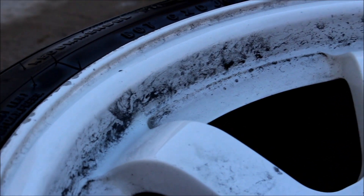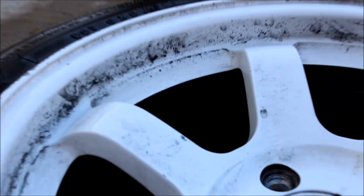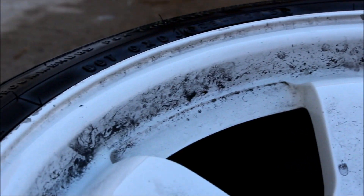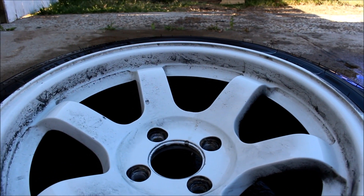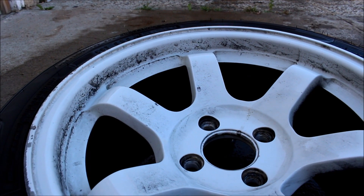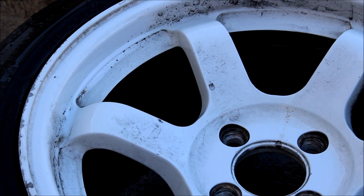See this? This is after I washed the rear wheel. People always ask me why my wheels are always so dirty. That's after scrubbing it with soap — that is from my beautiful Carbotech AX6 brake pads which perform amazing, but the dust, oh my god. It's not just the amount of dust, it's how hard the dust is on the paint. I literally sand off the dust. I use 3,000 grit sandpaper and wet sand it and it comes right off pretty easy. I've also used rubbing compound — it'll take at least an hour per wheel. I've just degraded to using 3,000 grit. If someday the paint gets so bad I'll just have them resprayed, really not that big of a deal.